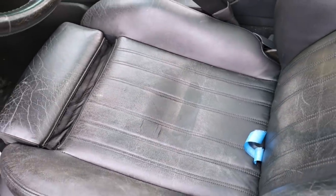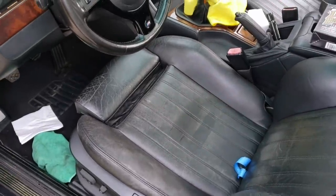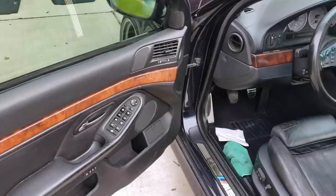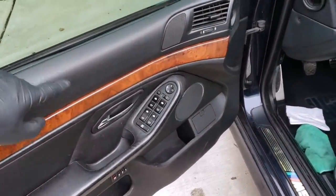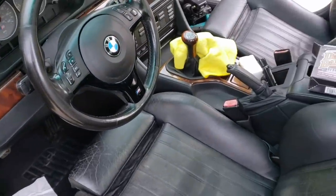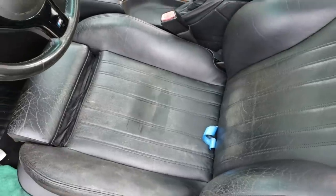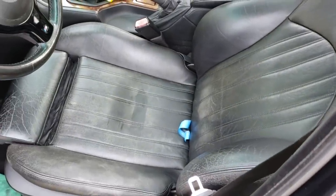Again, guys, I bought this stuff on my own. I just wanted to find the easiest and best product for a black leather interior. And something else that I'm thinking with the Doc Bailey's is since it's a conditioner as well as a dye and it has a wax to protect the leather, it's gonna work out really nicely because this car has the full leather interior package. So it actually has real leather on the door panels and on the dash. So I can treat basically the entire car with one product and you're done after about an hour. This is not gonna take very long to apply, let sit for a minute and then wipe away. Whereas with the Kiwi, we have to wait overnight. So right now I'm gonna do a tape line right down the middle and really show you guys the difference between treated and untreated.